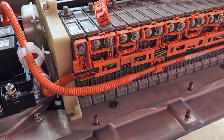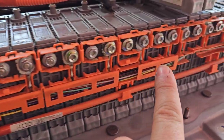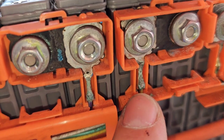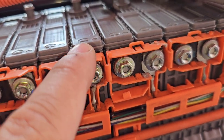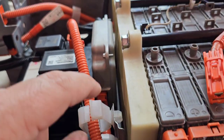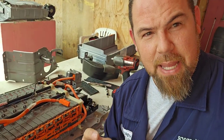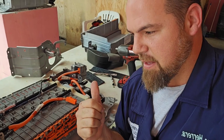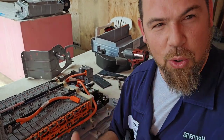But there's another very big mistake: even if you change the connecting lugs, we have another big problem — take a look at the cable monitoring system. Look at the corrosion between the cable monitoring system. This corrosion that comes from the battery will travel through this cable and finally reach the high voltage battery management system, which is going to cause a very big problem in the battery, because you will have bad readings. Because it's not reading properly, the computer cannot control the high voltage battery, it goes off control, and once again it's going to overheat. So everything finally reaches overheating the high voltage battery.